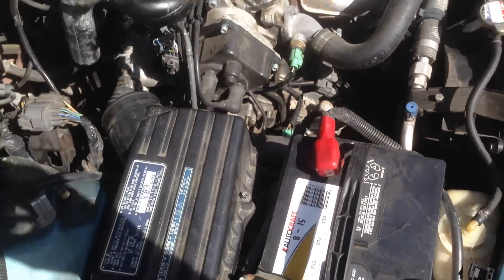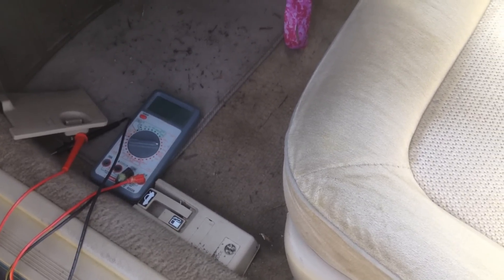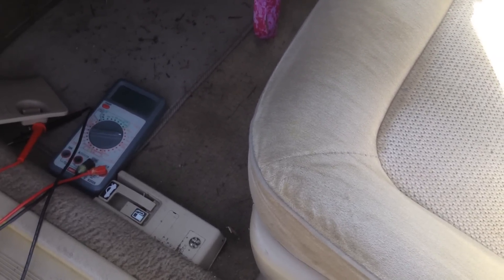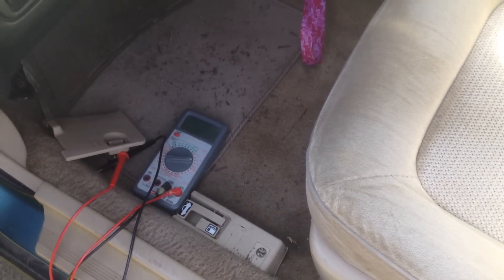If for some reason that did not work, I'll show you something real quick. On your kick panel down here, there should be a 10-amp fuse — I believe it's number one, one of the bottom ones — just check your fuses down there if you're having trouble with those not working. After you've done all that, if you're still having trouble, clean that connector with some electrical cleaner. If you know that your car is working correctly all the way up to that connector, it most likely is your vehicle speed sensor and it needs to be swapped out. Hope this video helps — give me a thumbs up if you like it and subscribe to see more videos as they come out.